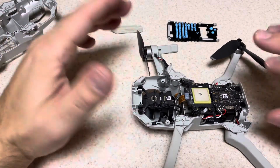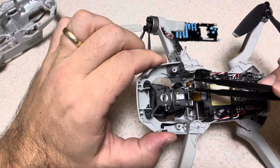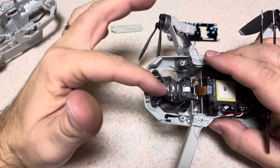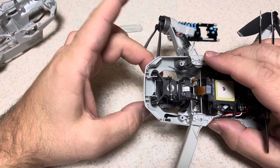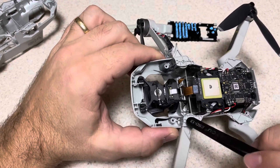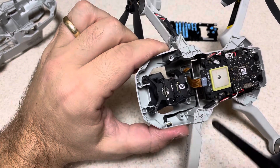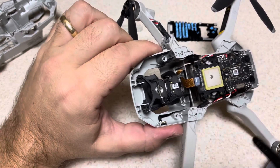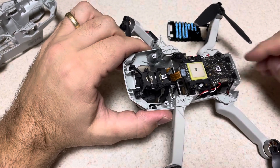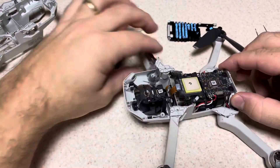The gimbal system is designed to account for rubber wear over time, and you can replace the rubber mounts. I would have liked to replace the whole plastic gimbal frame, but I couldn't find one sold alone — they're all sold with the camera. If you're replacing your camera, do your research first. Even though it connects plug-and-play with two ribbon cables and a threaded ribbon cable, you may run into programming issues where the motherboard doesn't recognize the camera, which limits repairs to in-house rather than third-party options.